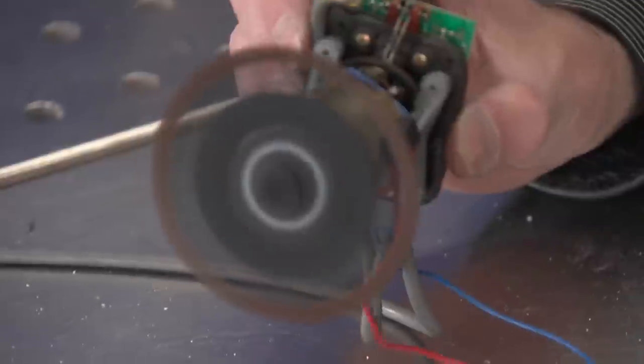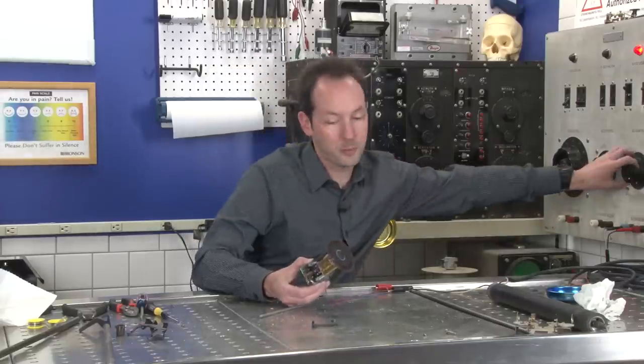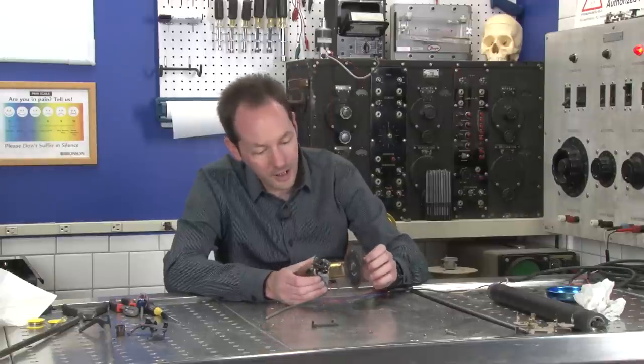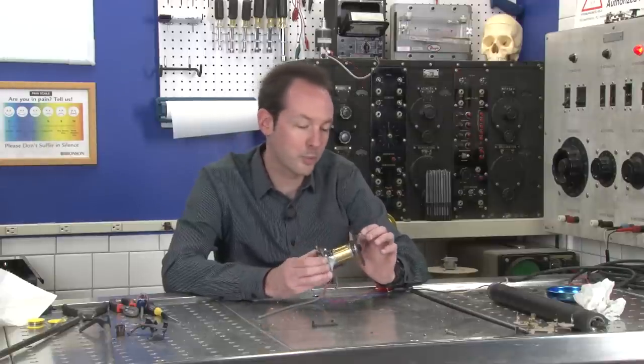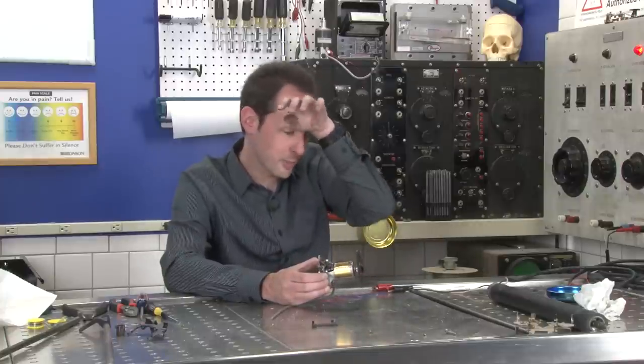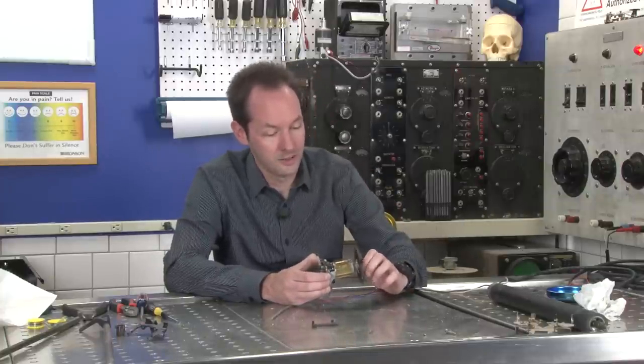So, we've got the daisy wheel and its motor, and that's pretty cool. And I'm glad that we got to get all the way down in there. That thing, I want to know how they do that with just a brush DC motor, because I get that there's a rotary encoder on there, but man, that had to be hard.